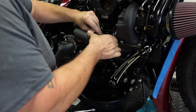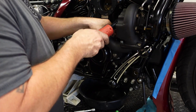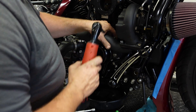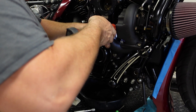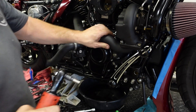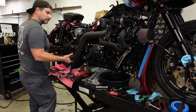The heat shield is attached with just two hose clamps. The trick is to try to put it exactly where it was so you don't have any witness marks — this is a matte finish and very easy to scratch. When the heat shields are attached they will leave a witness mark where they are.